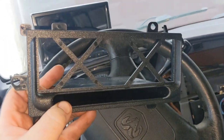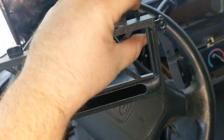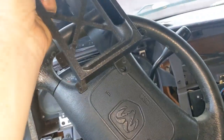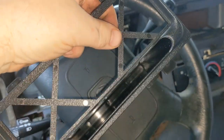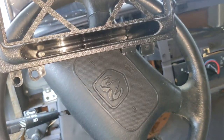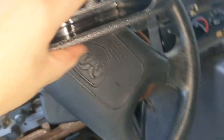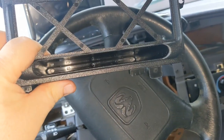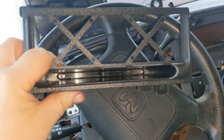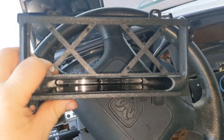This is like a universal thing for a Dodge - I've got to cut this tab and this tab off, and this one on the side, and then these X-braces I'm going to have to cut out. This pocket right here is just to take up space - I don't know what you'd slide in there, maybe a cell phone. I'm going to drill a hole in the back of it and run the auxiliary cord out. I'll run inside and trim all this up real quick, drill the hole, and we'll see what it looks like.